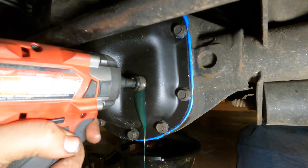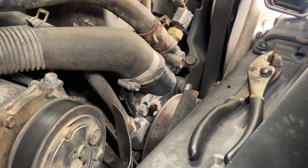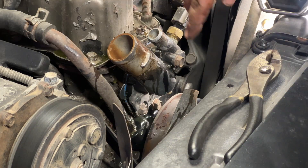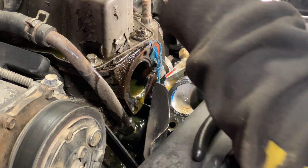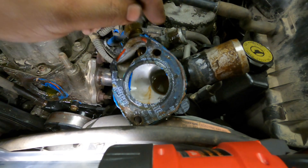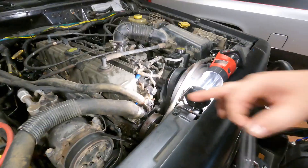Next project is the thermostat. We're at the front of the motor with the thermostat housing. I suspect the thermostat is getting stuck open and that's why I'm not getting any heat in the cab. It's going to make a mess - but I'm used to it. The thermostat housing is really easy - just two half-inch bolts. Lot of coolant. This thermostat looks brand new though. Scraping off the old gasket material on both surfaces, got the new thermostat in there and something that looks like a gasket on the housing. Screwed it back in.